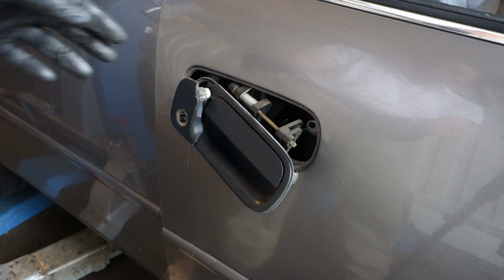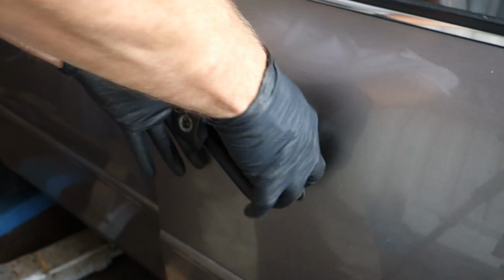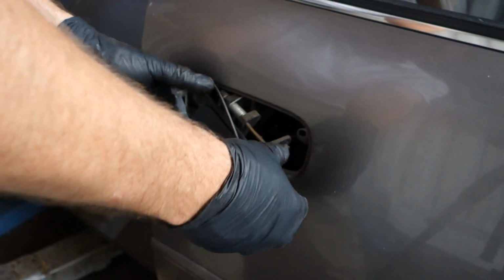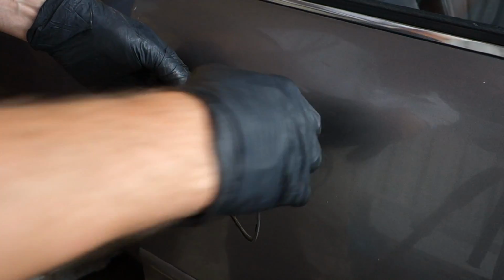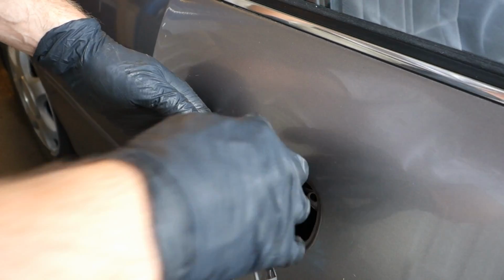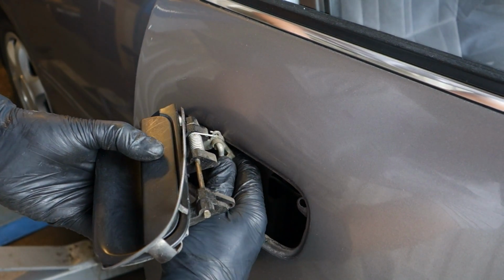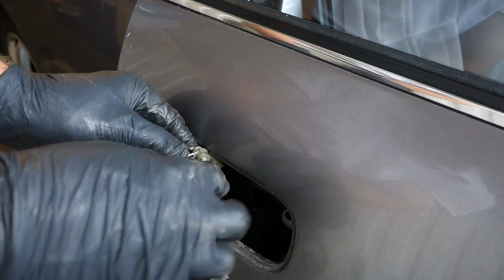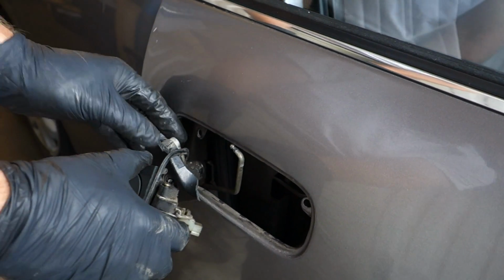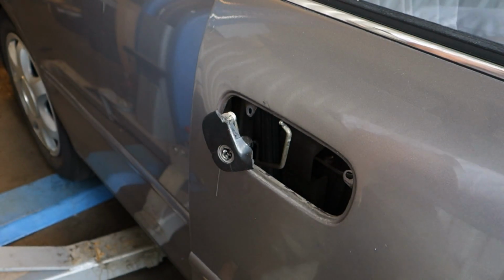Okay, and next I take this door handle away, and there are two things that I need to open. I need to carefully lift that in here, and the first thing is this part, and first I need to open this plastic lock, and I only move that a little bit in that position. In this way the lock is open, and then I can take this part away, moving that to the other side in this way. Now it's open, and then I have this second thing. Now this is easy to take out because this is broken. Normally more difficult.